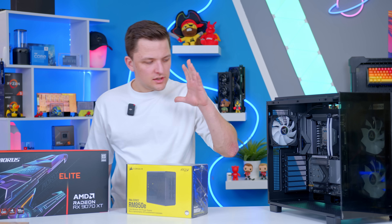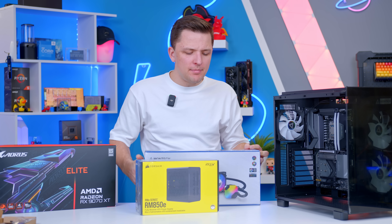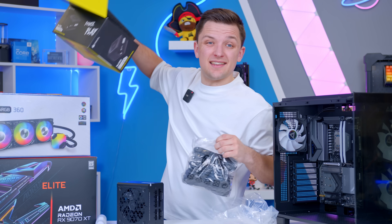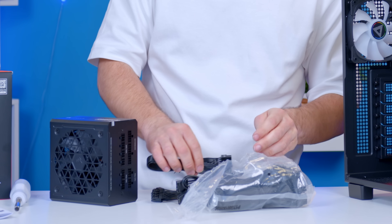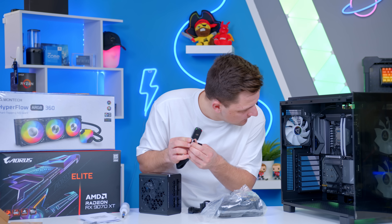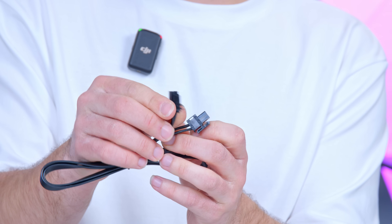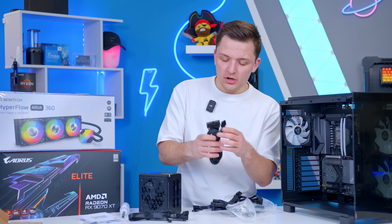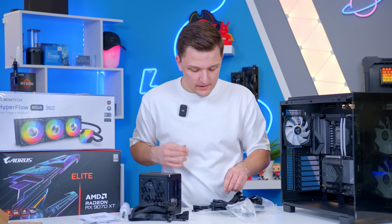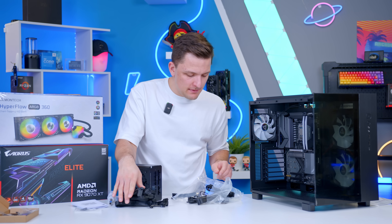At this stage you could carry on with the power supply or the CPU cooler — I'm going to do the PSU first, then pop the cooler in on top of the case. In terms of cables, you're looking for a CPU power cable that splits into two sets of four pins; on this board we need a double four — so eight — plus a single four. Then you need a motherboard cable, which is the largest and braided slightly differently, making it easy to spot. You'll also need SATA power for the RGB hub. The fans pre-installed by Montech make the cooler setup straightforward.